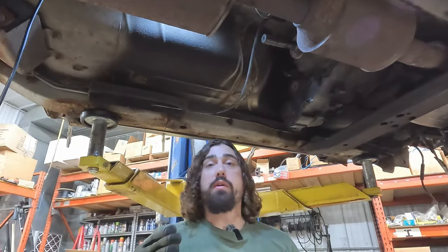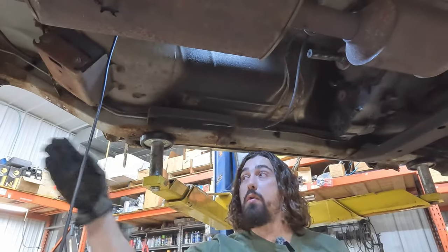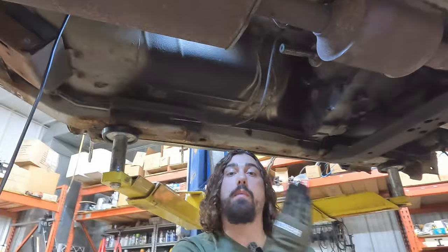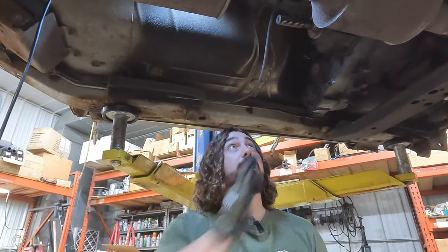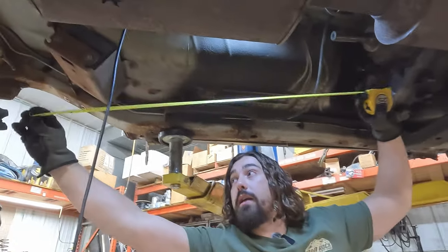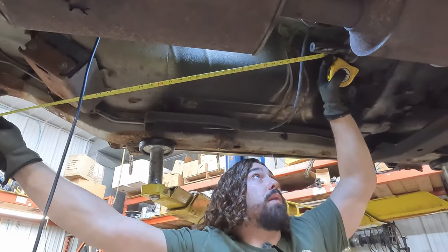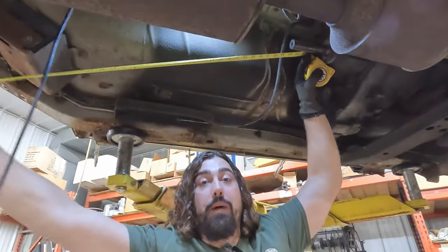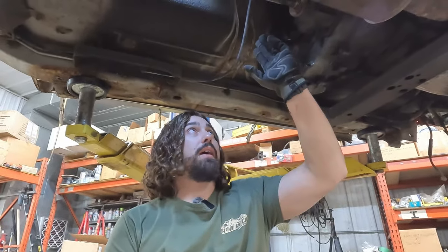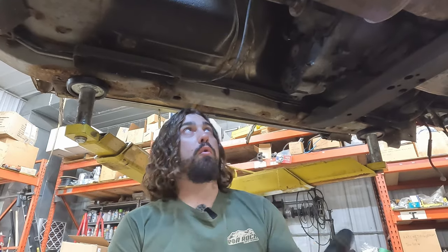When we're measuring, we're looking for 33 and three-quarter inches from the mounting face of the yoke — essentially halfway through that U-joint — up to the shaft. Now that I've marked my minimum amount of splines, if I'm forward of that line I can't use the 33 and three-quarter measurement for the OEM shaft. If I'm behind that line, we're golden. In this mock-up, my 33 and three-quarter measurement is behind my mark toward the rear of the vehicle. So I could run that OEM front drive shaft, but that's not the way this project's going. We're going to cut this output shaft right down to that minimum of inch and a quarter of usable spline, getting the longest shaft possible for the future of this build.